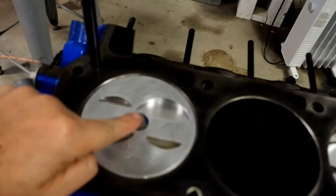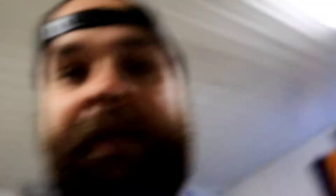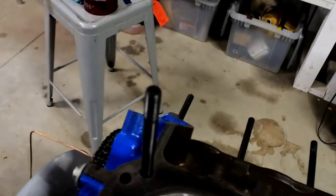If you'll notice this piston, I already did it on this one. Look at that — that one is beautiful. It's cut out. There's the factory size, and there's what I did. Guys, I'm impressed it worked so well. So initially, let me show you this tool that I made — I showed it in an earlier video. Here's my tool. It's not super clean, and I was just going to drop it down through the valve guide and just ream it out. But I've got a better way to do it.